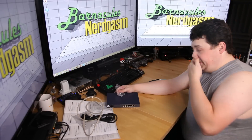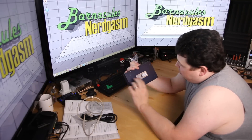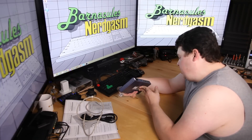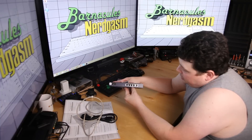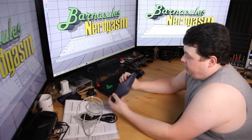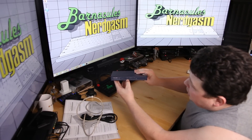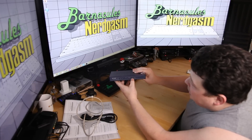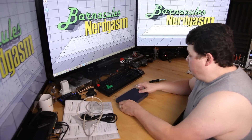And that's about it. Very simple packaging. So it looks like we just hook it up and plug it in. On the bottom it's got a MAC address and a serial number — the MAC address is used to send to the ISP. On the back, the ports are labeled: one is LAN, three can be configured as WAN or LAN, and one is labeled WAN explicitly. On the front you have a power LED, a system LED, a WAN LED, three that can be WAN or LAN LEDs, and a LAN LED. If the LED is orange it's WAN; if it's green it's LAN. Very cool stuff.